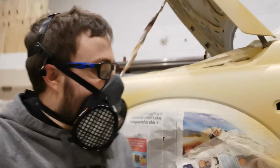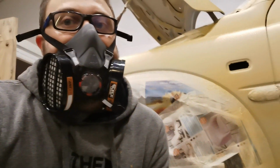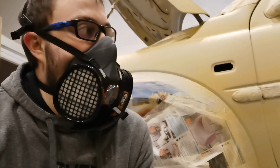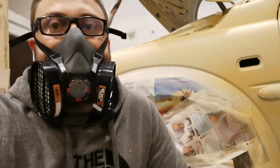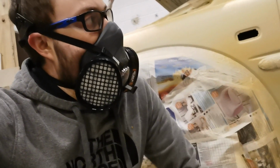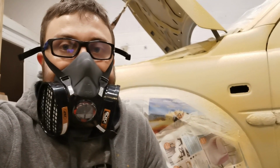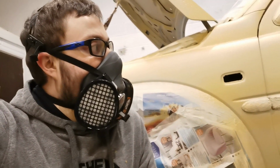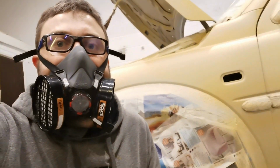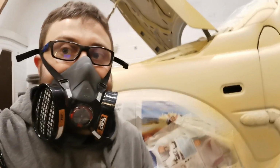I think I'm probably going to stick with 120 ml of thinners. I was looking at maybe doing less thinners as I went on, but I actually quite like the finish of it. I'll see how it dries up and I'll see how this car looks Monday. It's a lot finer and a lot more sandy, which is what I wanted. If I like it, I will keep it at that. Maybe do one coat with a little bit less in it, just to thicken it out a little bit. The actual paint I do like. It's just a bit of an unfortunate situation at the moment. So, hopefully I'll see you guys Monday and we'll pick it up from there.